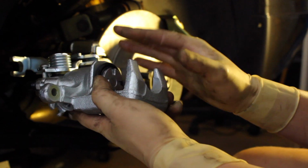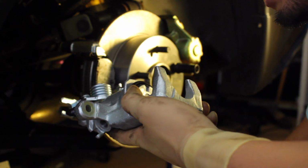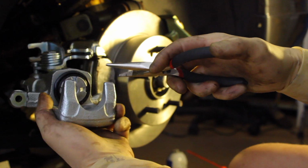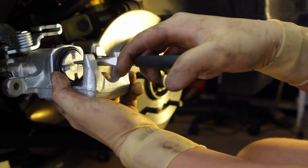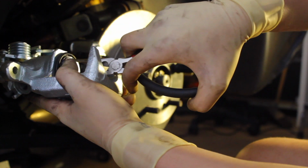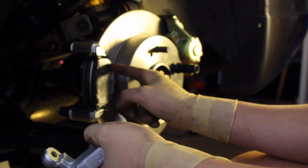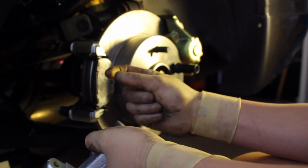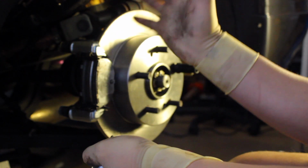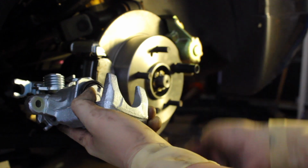One more key thing is that before you put your brand new caliper back on, you want to compress the piston. And to compress the piston, all you gotta do is get some needle nose pliers, like so. And then you see these little grooves right here. It looks like a plus sign. I'm trying to get it in the camera. You want to basically just put your needle nose like that in it and rotate, basically until it's fully compressed into its spot. If it's sticking out, you're not going to be able to get it over your brake pads, because the thickness of the pad is not compensated for when you had removed it, if you were doing it like a brake job. But pretty much, yeah, key tip: some needle nose pliers, rotate the piston, and you'll be good to go.